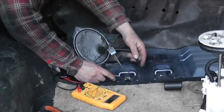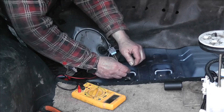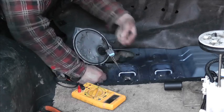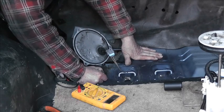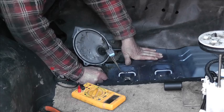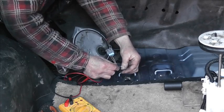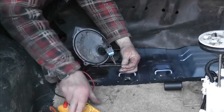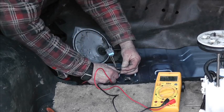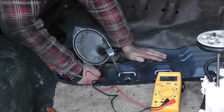This is on voltage. Okay. We've got no volts there at all. Well, it's a ghost voltage, 0.3. Right, okay, so there's no point plugging that other one in, because it doesn't work. Because it does work, but this wire is all wrong. Okay, so we've lost the voltage there. Yeah, just try that again. I doubt if you'll be able to see that, but there's a ghost voltage there of virtually nothing, 0.02, and those are the right two wires.